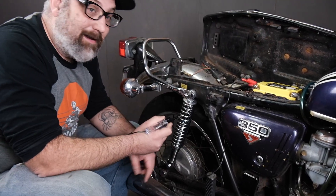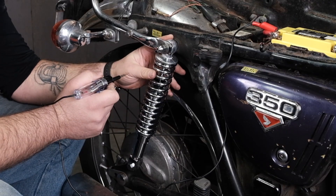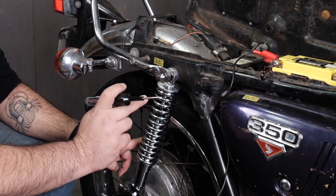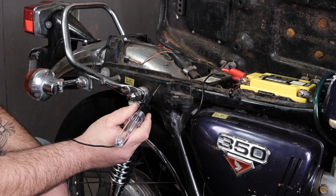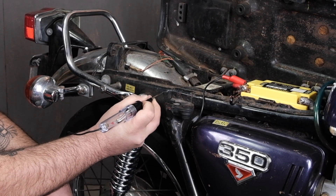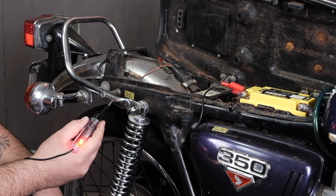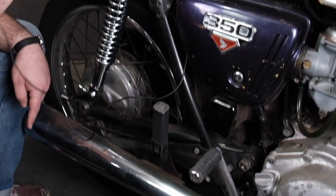How about the rear shock? Wait — no light. Well, let's talk about that. The shock itself is actually rubber mounted; it has a rubber bushing at the top and a rubber bushing at the bottom of the shock. Therefore, the shock absorber, although it's metal, is isolated from the rest of the frame. Also, things like painted surfaces — just like the middle of the frying pan — are not going to make contact. But if I scratch away a little paint, you have contact. So remember: paint or corrosion can cause insulation, but otherwise we still have many things that are ground.